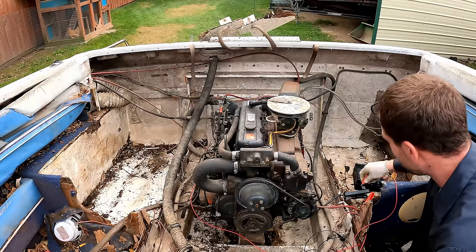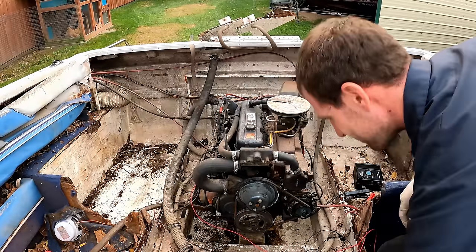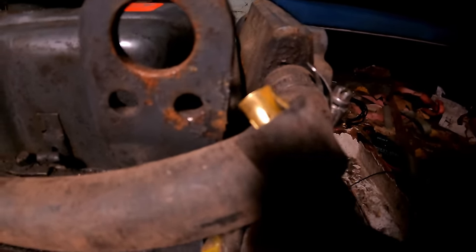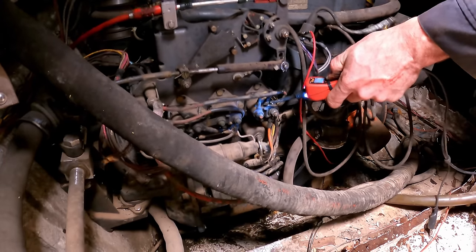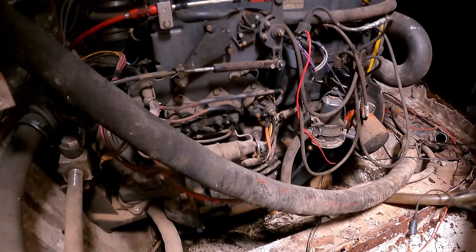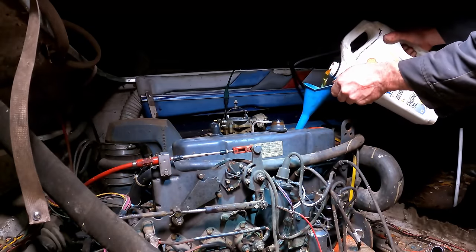Got that starter in. Let's hear this first crank. Does not sound good, but let's throw the plugs in. No spark. Wow, that's jumping. Huge gap. I just needed to run a little sandpaper across those points. Well. There she is. I'm now gonna suck the rest of that milky oil out and fill her up with some fresh.